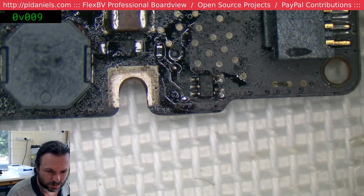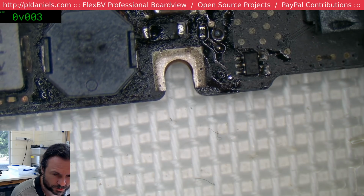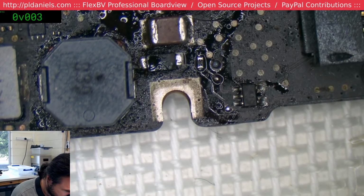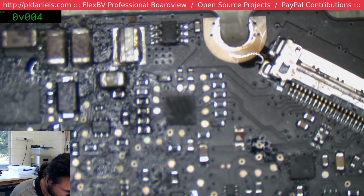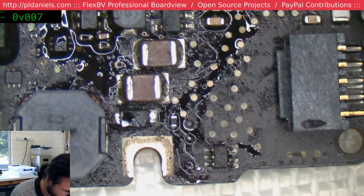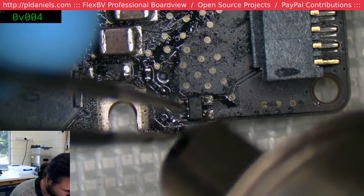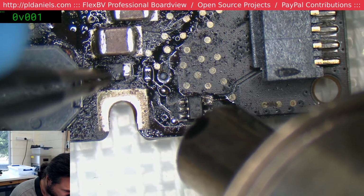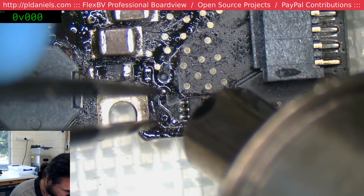Yeah, okay, Paz, I would too. The MOSFET was on the opposite side of the resistor you just replaced. As in there? You mean opposite side of the board, or maybe you meant U6901 here. Make sure we don't melt the DC in connector.